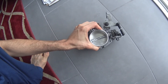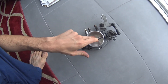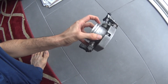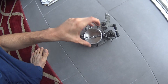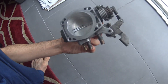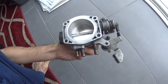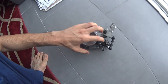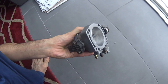You don't need to smooth it out super smooth because it won't make much of a difference in terms of airflow. You can do more, but just be careful that you don't go through that lip because it's indented and that could cause a problem — breaking this piece right off. So that's something to do if you've got a couple hours to burn. It probably won't make a huge difference, but it was fun. At least I cleaned the throttle body. You can put some oil on these joints and put it back on the car.